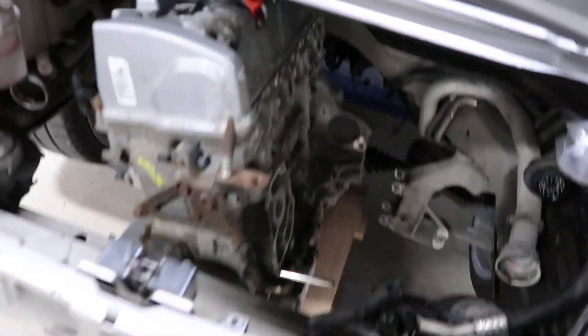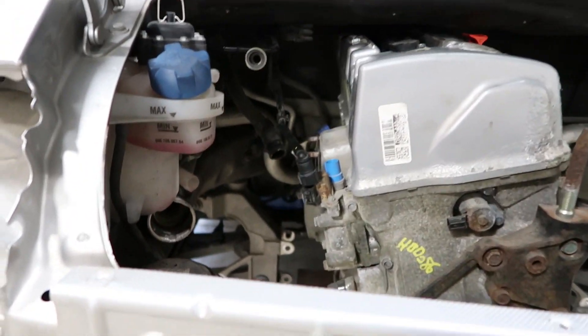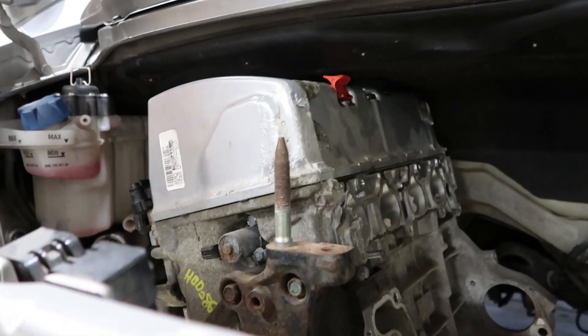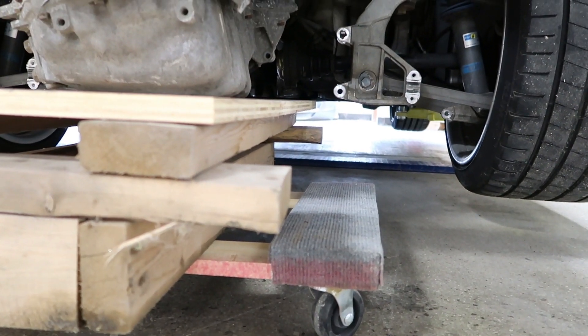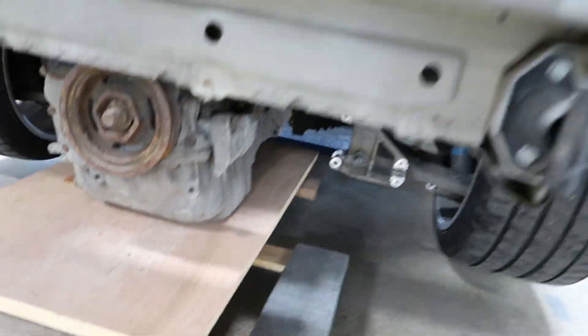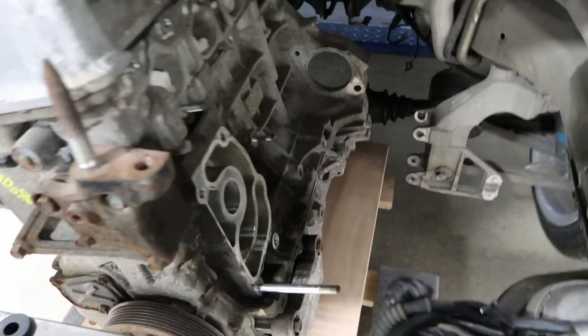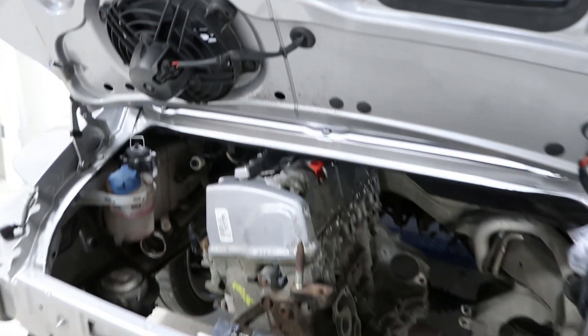It's in - this fits really well. Lots of room, lots of room for a turbo on this side, and height-wise it's not nearly as bad as I thought it would be. The oil pan is in line with each frame rail, so I think we're in pretty good shape. It clears the accessory pulley and there's enough room behind. I was concerned the motor would stick forward more - unfortunately it will hit the fan so I'll have to remove that fan, but man, there's tons of space.